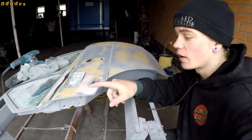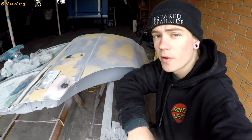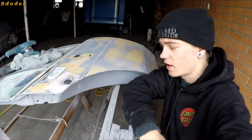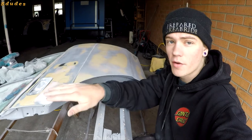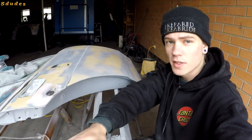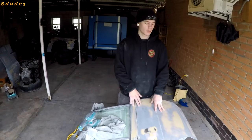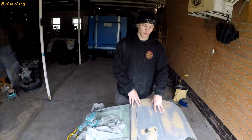This spot here had a bit of surface rust, so it became a high spot. I sanded it back to bare metal as much as I could, but it was still too high and I didn't want to hammer it out. So like the surrounding areas, I did a light skim of bog to make it all even. Once the primer is on, that'll blend it all in nicely. I'm pretty happy with how it looks — nice and straight.